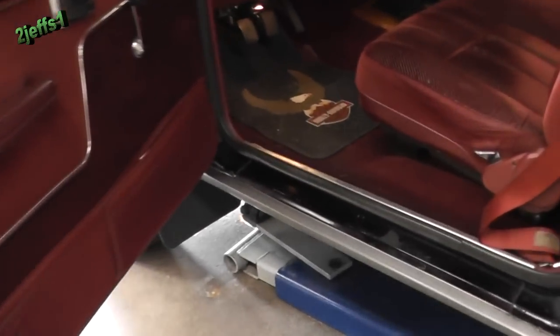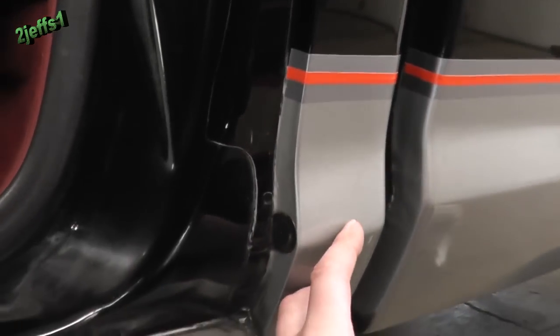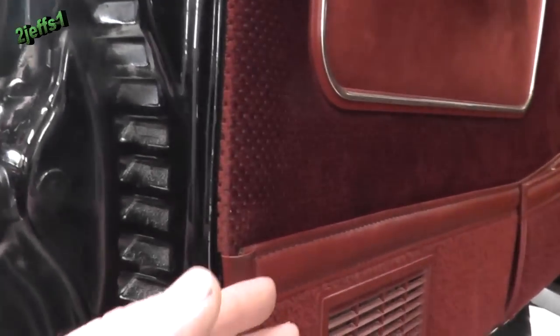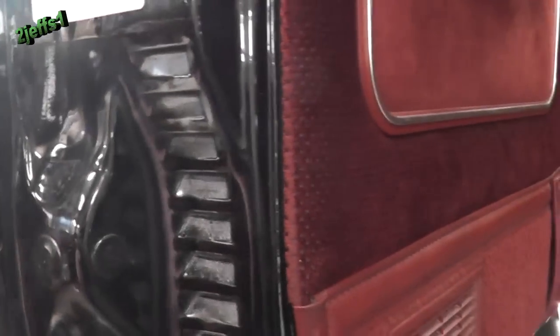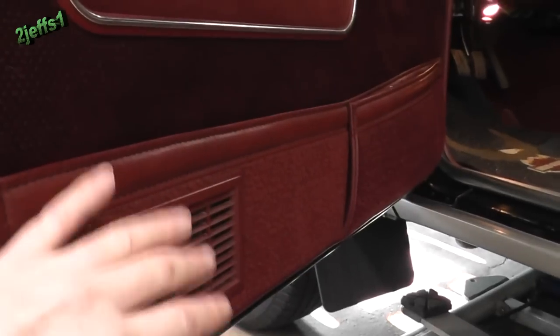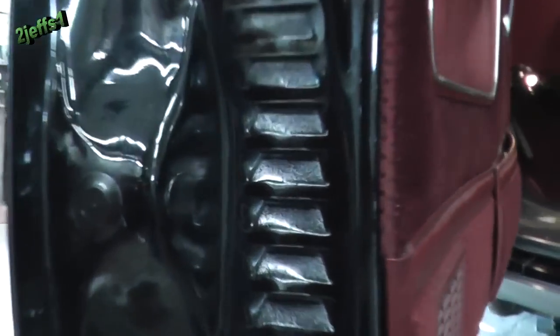To prepare the vehicle you're going to have to drill holes in strategic areas. Anywhere there's a double wall you'd want a hole to get into those areas well. On the door, you might want to take the panel off so you know what your drill will hit going through the other side. There's a speaker in the door — you want to make sure you're not going to get oil on it. Some doors have a plastic panel on the inside. Know all of that before you start oiling.